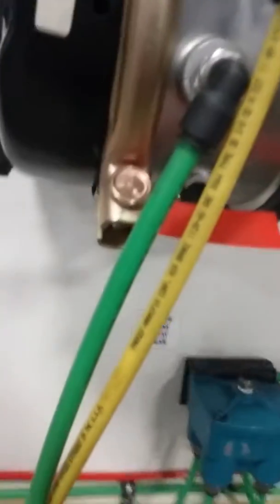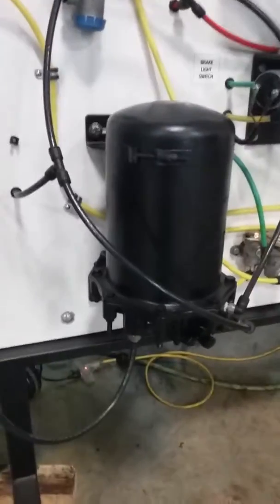The relay then splits to all your different chambers. You can see the green hoses are your supply and the yellow is your return. This right here is where all the magic happens — this is called your air dryer. The air dryer dries the air and takes all the contaminants out of the air being supplied from the tank.